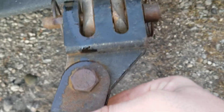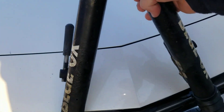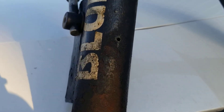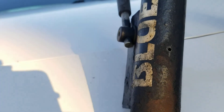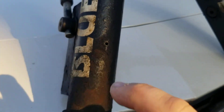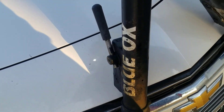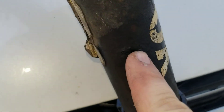This one I'm not sure if it moves — they both collapse still. When it's up like this, the manual doesn't teach this, but right down here on the Blue Ox Acclaim there's a hole — you need to keep that hole clean. Spray oil in there, not WD-40. WD-40 is a penetrator and does not stay after it's done — maybe a week. Oil stays and gets everywhere. You need to oil these pistons because if water gets in, it freezes up. Inside there's a plunger, and if it rusts, that plunger can't ride smooth. There's a hole on both sides — that's where you oil it. Shooting through the front does nothing, and WD-40 actually makes it worse.